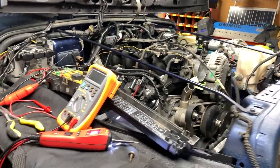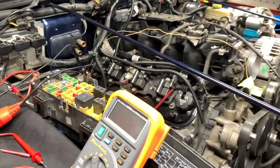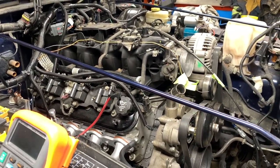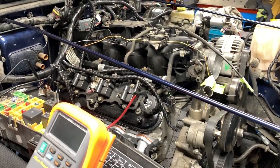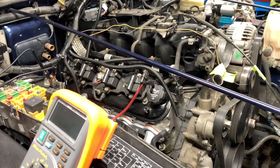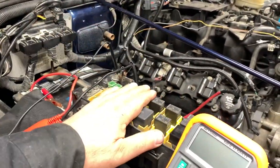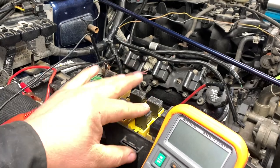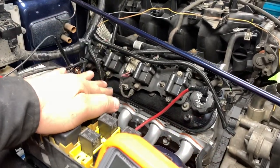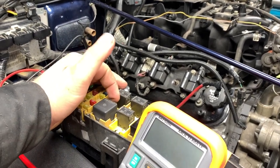This is just a quick troubleshooting guide. Obviously if you suspect a problem and the O2 sensors are at fault, your computer will usually give you a code telling you something has shorted out — that's a pretty good reference. But if you suspect the ASD relay is failing, you can always swap it out with another relay.